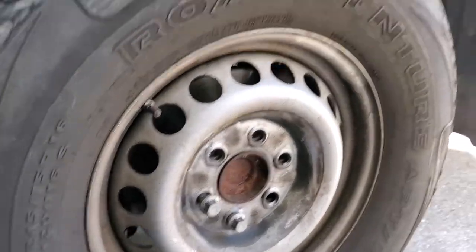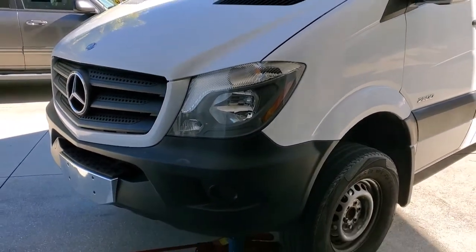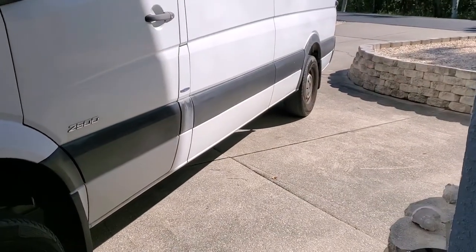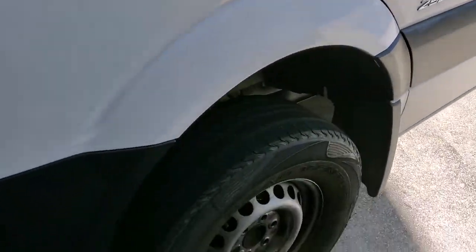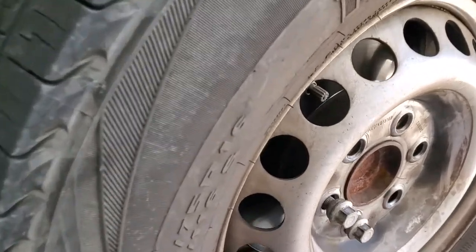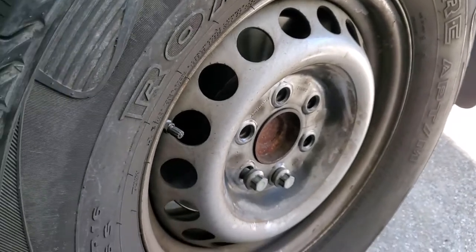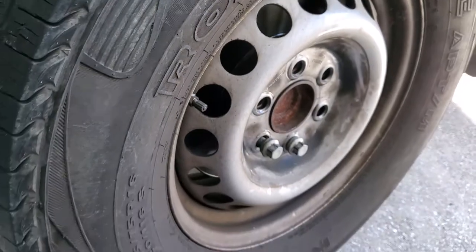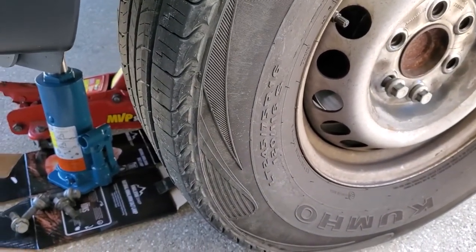I'm changing the brakes on a 2014 Mercedes Sprinter — the four-cylinder, single rear wheel version, not a dually. I'm doing the front brakes first because my dash light came on indicating wear. You can actually drive it quite a ways once the light comes on. I looked at the meat on the pads with a flashlight through the hole and I've been driving it maybe 300 miles since the light came on, and it doesn't even look close to gone.